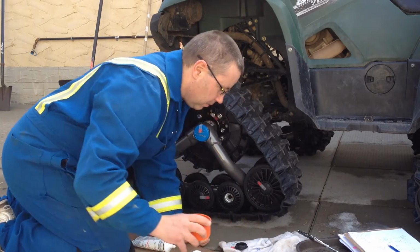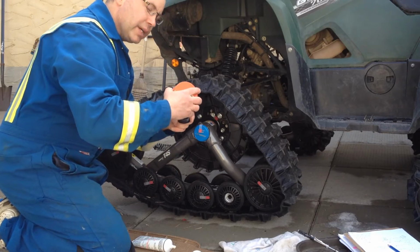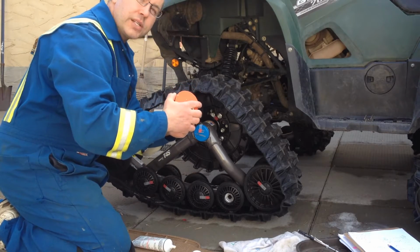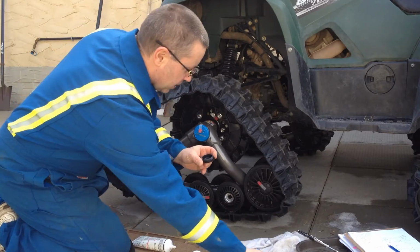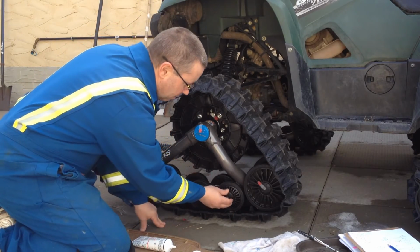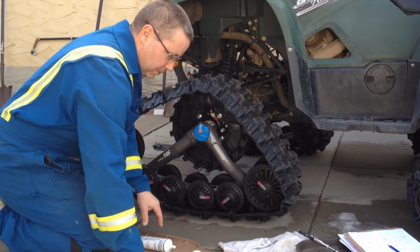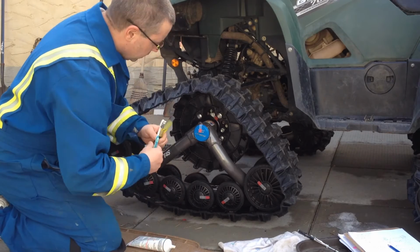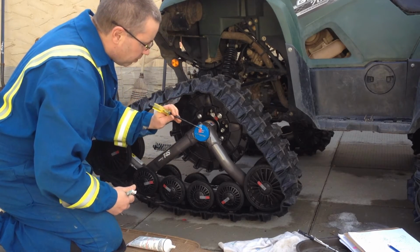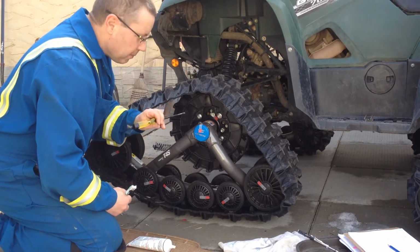Now I've added oil. Manufacturer spec says add some oil to the cap. It gets up any large debris so it doesn't go within the bearings. Perfect. And around. Put that cap back on. Perfect. In here, inside the bearings, here's the main wheel bearing cap. We take this off and grease it up the same way.